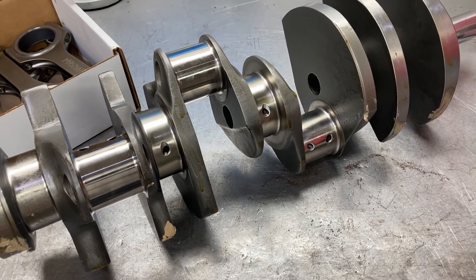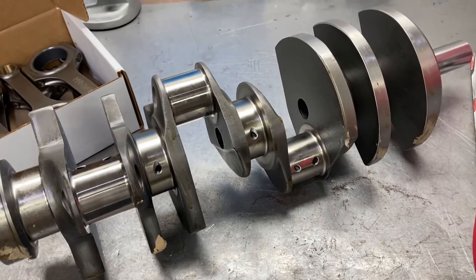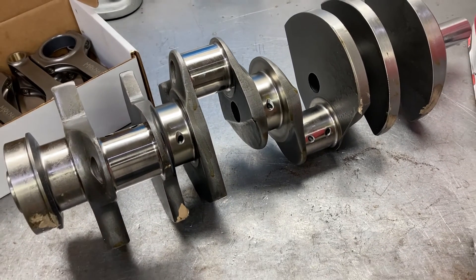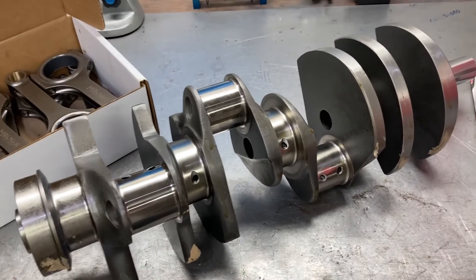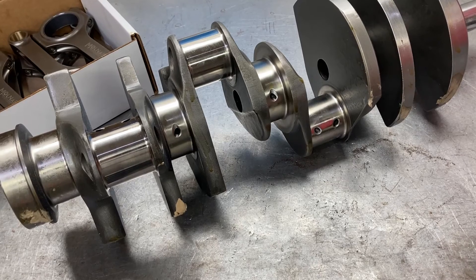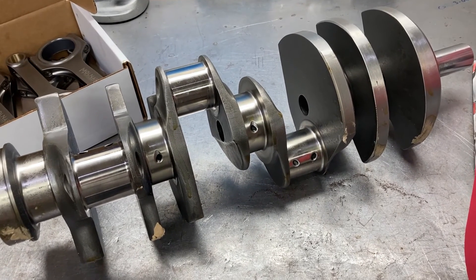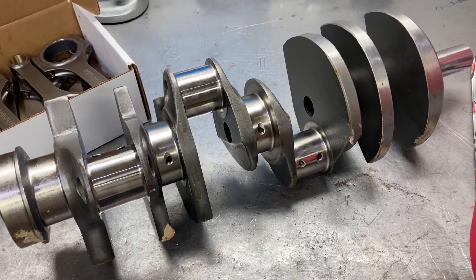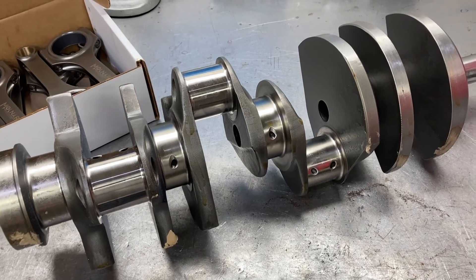Typically they start out with a 2.070 and 1.650 valve package. We're going to use a 2.250 intake valve and a 1.650 exhaust valve. We're going to break from the traditional 3V intake, and once the cylinder heads are done, I'm going to be sending both heads to Dave Hughes of Hughes Racing Manifolds. We're going to have a sheet metal intake built for this engine. We're going to throw a couple of Q850 Quick Fuel carburetors on top, and we're going to be at around 13 to 13.5 to one compression. Got a solid roller camshaft coming — actually, it's already here.